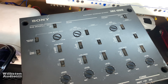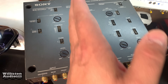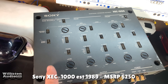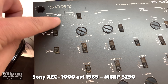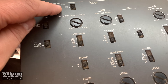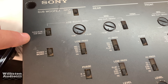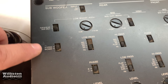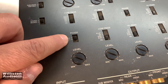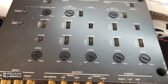All right, so here is a Sony XEC 1000 crossover. It looks a little confusing but it's pretty simple. There are three different sections here on top of the crossover. The far left is for the subwoofer — you can have the input for the subwoofer on, or you can just use the front and rear inputs. That's what that switch is for. Low boost — you can have it for the sub only or the sub and the rear channel. Tell the sub to be stereo or mono, what frequency the low pass, phase plus or minus, and then your level adjustment.